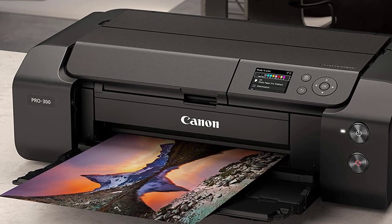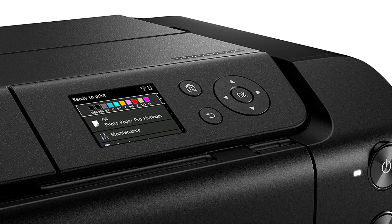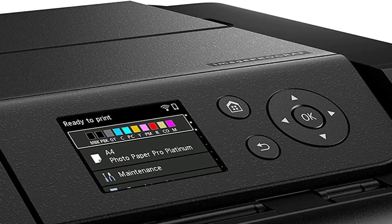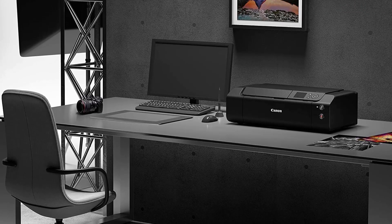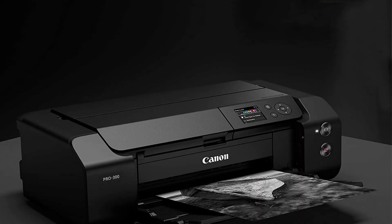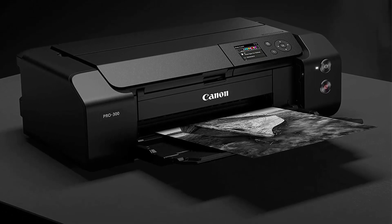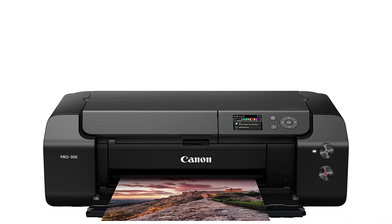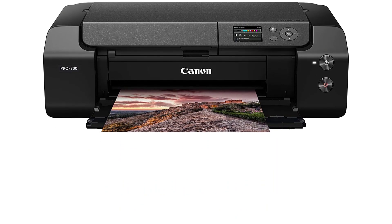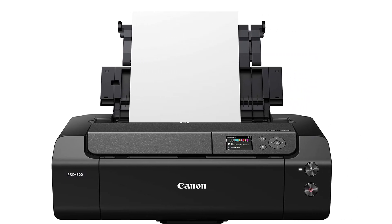Aside from containing the right mix of colors, it has a deep matte black and other darker shades for vivid color representation, especially on glossy paper. The printer can automatically decide on the droplet size and layout based on the printing surface, thereby saving ink and printing time. There are separate nozzles for photo and black prints, and the nozzle recovery system keeps blockages to a minimum. Two paper feeding trays — one on the front and one on the back — both come with pull-out support extensions to keep the papers in the right position during the feed.